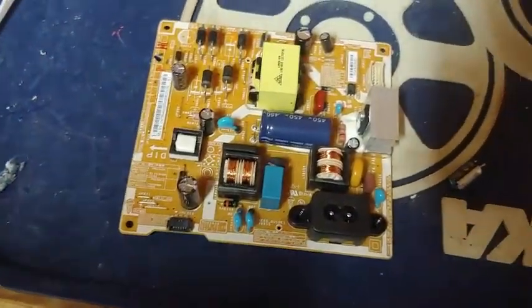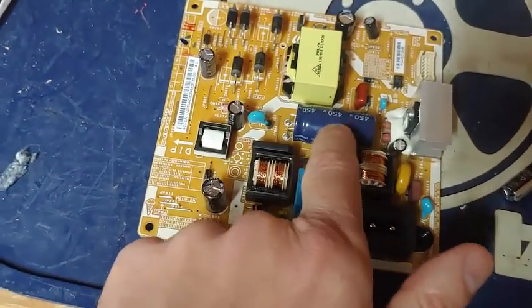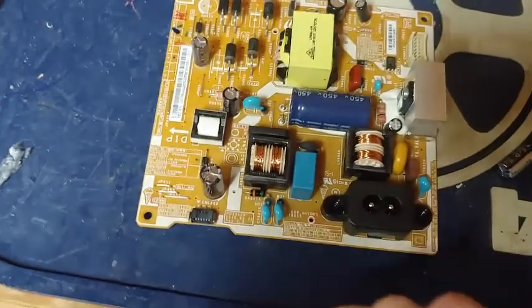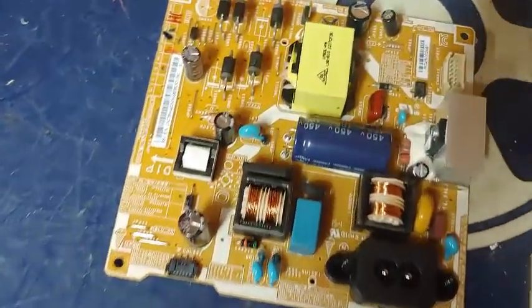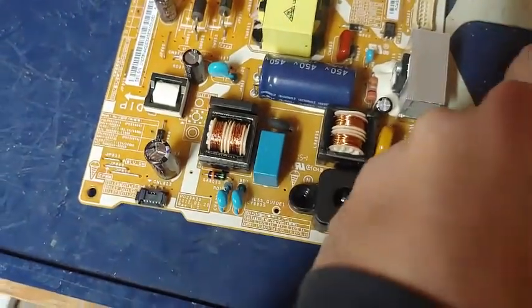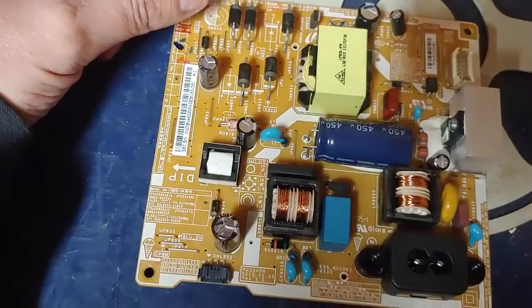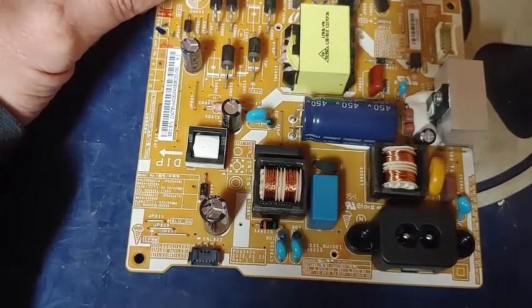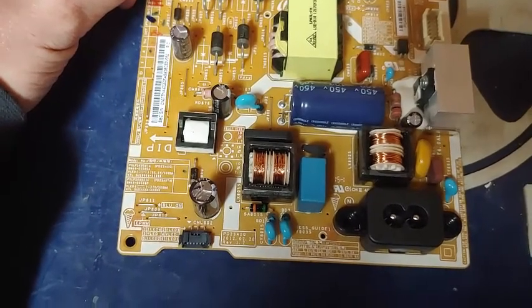By the way, you need to be careful of this largest capacitor — I understand it can carry enough voltage that could kill you. See, it says 450 volts. I looked at my main board when I took it out. You'll have to find a video or figure out how to take apart your own TV because they're all a little different.